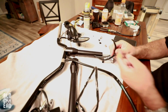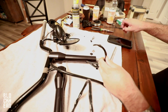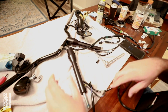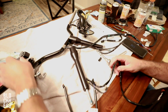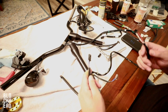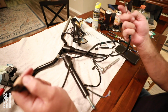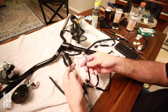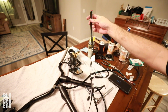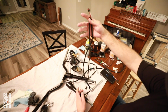Right through. Now I'm gonna take the tape off, repin everything, and then we got extension harnesses we're gonna hook up. And then I'll be ready to go back on the bike. We're pretty much done with the left side controls. We got the controls here wired up, right? Since we got the risers on here, we're gonna add these extensions that we got from Harley. So it's pretty much just plug and play. We repinned everything. This is for the turn signals. That's all it takes. And now we extended the harness. This will plug into the harness on the bike. That's plenty long enough. That's why there's no extensions for that.